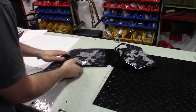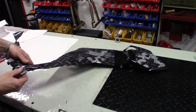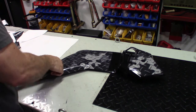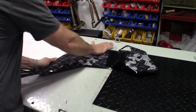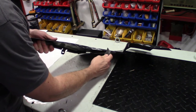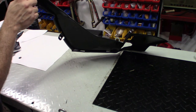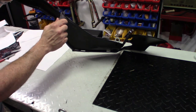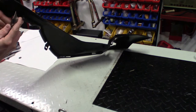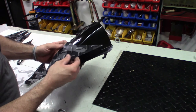Another tip is if you have a heat gun, you can actually stretch these out a little bit as they're being applied. You don't want to overheat them, but a little bit of heat will allow a little stretch. They're not vinyl — this is actually a sticker, and vinyl is different. I'm smoothing the edges out and cutting any little bit of excess off. Don't leave any overhang because if it overhangs, you'll get moisture in there and it will start to peel the whole sticker.